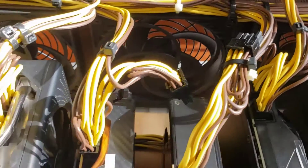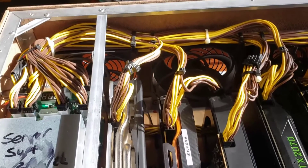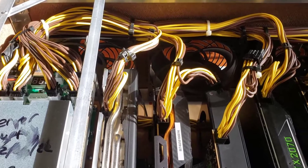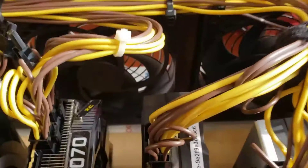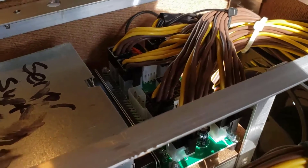All the wiring is custom built, 16 gauge. After listening to a recent interview with the CTO of OctoMiner, I will not do that again — I'll switch to 18 gauge wires. All of my connectors are soldered just to make sure they're extra good. There are 140 millimeter fans in the back, and all those wires go around to two X6B breakout boards from Parallel Miner.